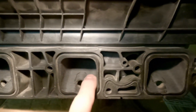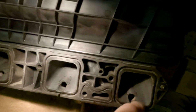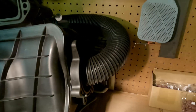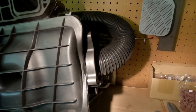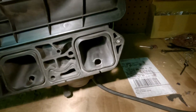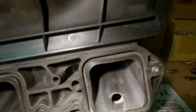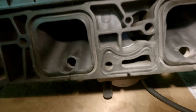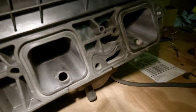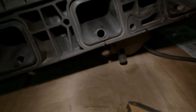This is where we're at after going to 600 grit — it feels pretty good. I know it doesn't look the best but it's fairly smooth, and I'm going to clean that up with some scotch brite for the final finish. I've got my vacuum in there so it sucks all the little plastic shavings out as you're doing this so they don't build up. After the 600 grit and the red scotch brite, it's smoothed up quite a bit. Now going back with the gray scotch brite last.